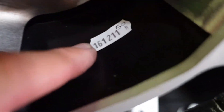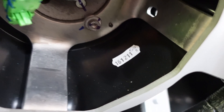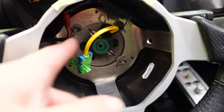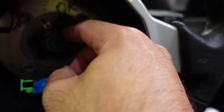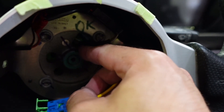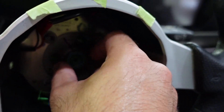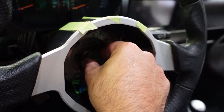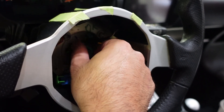We found that this is the 50th steering wheel on any Roadster ever made, which is about what we thought this car was in the sequence. And check this out — the steering wheel nut isn't even torqued down. See that? The owner's been talking about how the steering wheel shakes on the highway, and this may be why. I would bet money on it.